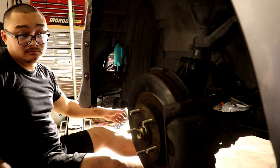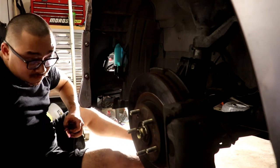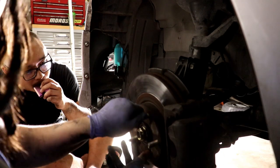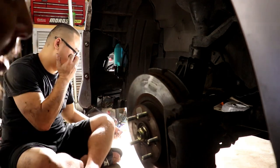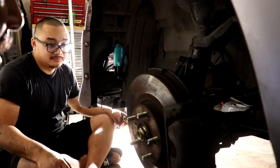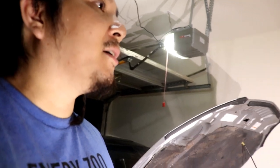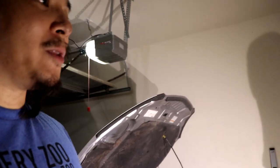We did that side. I gotta be honest, we're a little sketchy on these axles because we forgot to do it on camera, and Steve broke out his calipers and there were a few spots that seemed smaller than they should be, but it's working fine as far as we can tell. We're gonna put the wheels back on, put it on the ground, and torque the axle nuts down to spec — I think it's 120-something foot-pounds. We'll look it up. Then we go for a test drive. We didn't record it on camera, but be sure to stake your axle nuts — axle nuts are torqued down, lug nuts are torqued down, and we are about to go for a test drive.